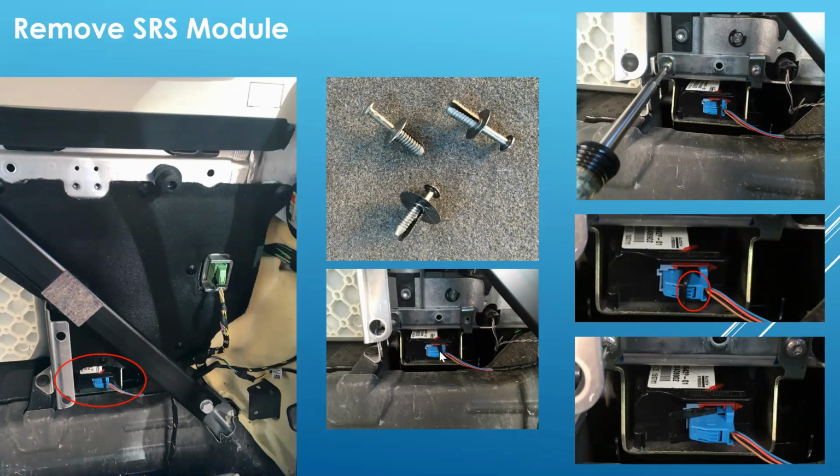And to remove the wiring, you press down on that little blue button and slide the black lever over to the left, and that will release the electrical connector. Basically, you pull straight out on the metal casing around the module. That releases the whole module, and you put your new one in, put the screws back in, put the plug back in, slide the lever over to the right, and you're done.